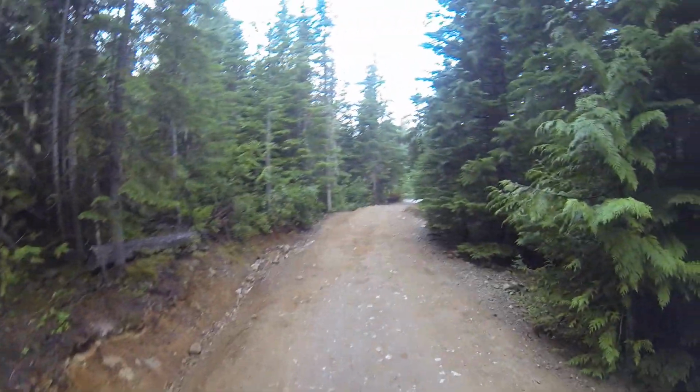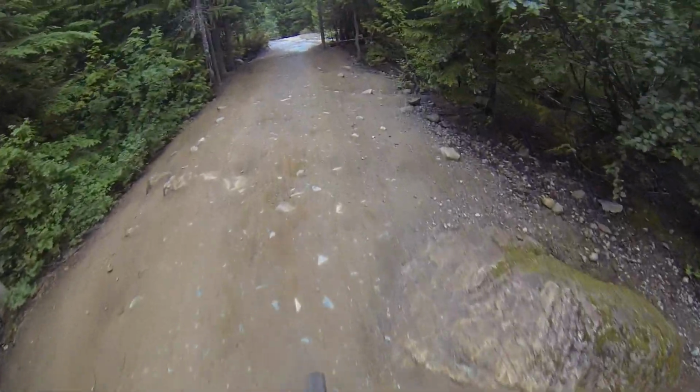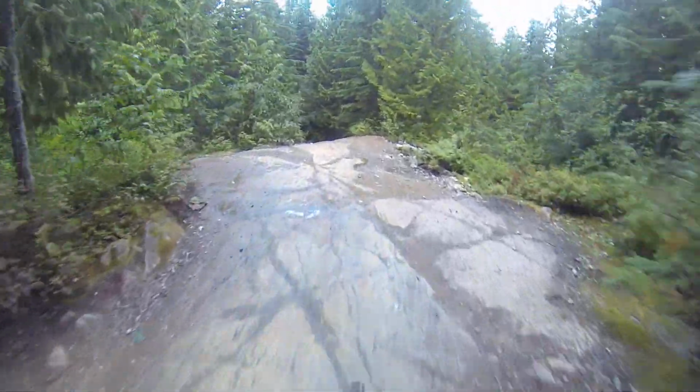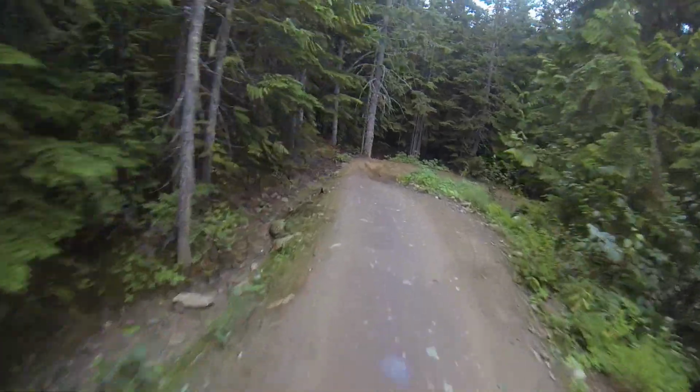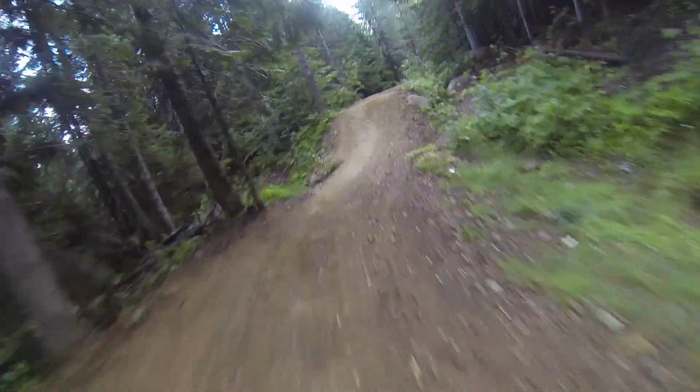But for the bike park, as you can see in my video, I did not like it for Dirt Merchant. I found the bike had a lot less pop than a lot of the other downhill designs. You could adjust this or minimize this by decreasing the rebound to get it a little bit more poppy, or potentially running an air shock instead of a coil to get that extra progressiveness to make it more poppy. But I did find it quite hard to pop.